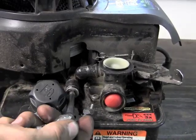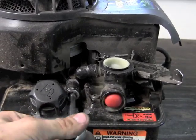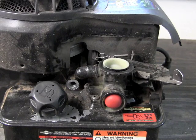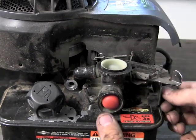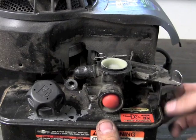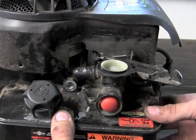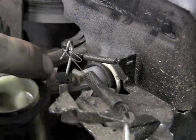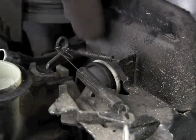I'm going to take the half inch and go ahead and loosen this one up. My spacer is just hanging in there with a little bracket. I'm going to take my 3/8 out. Now with both bolts taken out, this whole thing is loose. I'm going to pull it straight out from the motor — that's going to take it off of the intake manifold — but I'm still attached to the linkage right here. This linkage has a Z-bend in it, so in order to take it off I've pulled the carburetor and the gas tank out from the engine, off of the intake manifold right here.